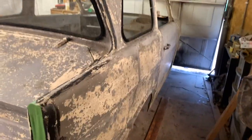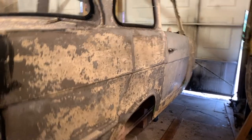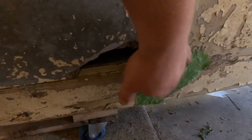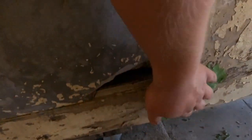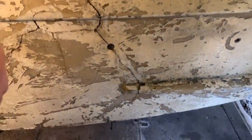So, we've done that. If we come round to the driver's side, you'll notice the door's in place again, but also the sill is on. So the driver's door does need a repair. The bottom of it is totally ripped off. This needs fiberglassing still, which is a simple repair. And the sill is in place, so it needs a bit of fiberglass done at the back as well, because a clamp was there. This panel is all repaired and in position.